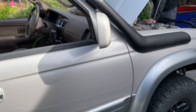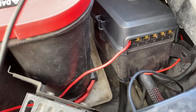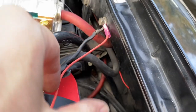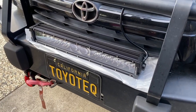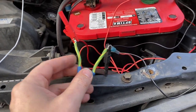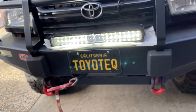Tim has a 98 and there are some slight differences between the years and even variations in trim level — base model, SR5, or Limited. Sean has a light hooked up just for demonstration. His first circuit connection is positive, and the negative runs via alligator clips straight to the body ground. The Auxbeam light is just sitting on the bumper to show how it works — the harness was simplified down to just the necessary plug. With the accessory on and the light stalk turned on, he hits one of the buttons and the light powers up. These switch panels are pretty nice.